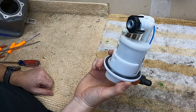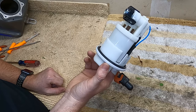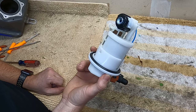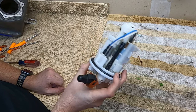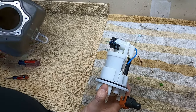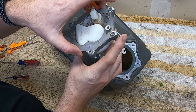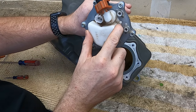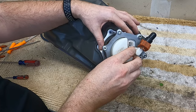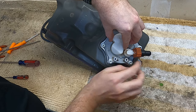And there you have it — that is the disassembly and reassembly of the fuel pump. Again, this is out of a 2015 Yamaha YZ250FX. This should work for the 450F, 450FX, and the WR250 and 450 — as far as I can see it's the exact same pump for all of the bikes, but if I'm wrong please let me know. All you have to do from here is put the sealing plate back on. One thing to note: you do have a little cutout here for a dimple to line it all up properly. There is a mark on the tank for the dimple to line up for the fuel line connection.